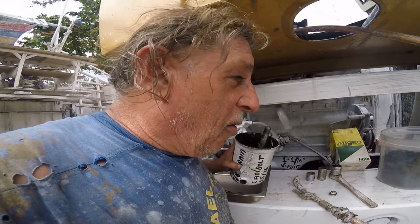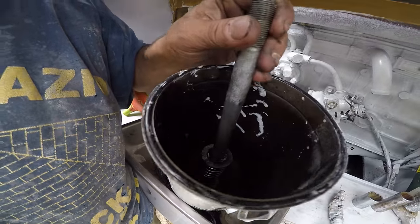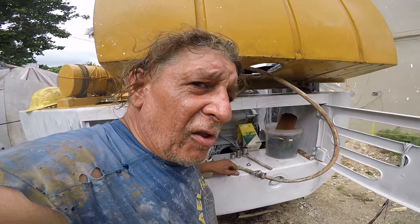If you have no filler plug, you just take the oil filter, put it in the canister, and if it's a vertical mount with no bolt on the bottom, you naturally fill up the canister with oil so it saturates around the oil filter. It depends on the oil filter type, but remember: the point of this video is to show you that you need to pre-load your oil filters, or too much time will elapse from when oil is pumped into the oil filter cavity to when it gets back into the bearings. You do not want to run the engine without pre-loading your oil filter and canister. Thanks for watching — this is Michael Fazio in the Philippines.